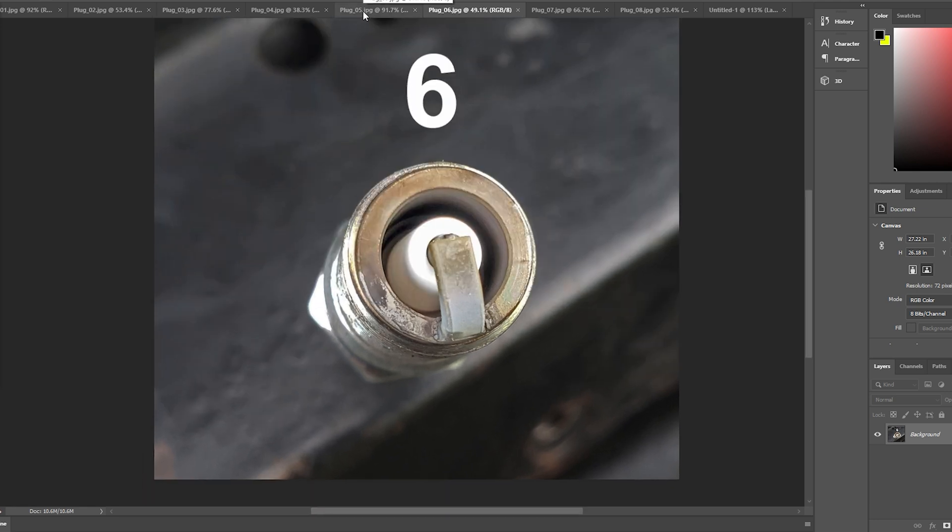That's pretty much all I've got for today. I'm not a plug reading expert, but I am going to invest in some more tools — something like an otoscope or a magnifying glass with a light so I can look down into the plug more easily to see the fuel mixture around the firing. That's really how you want to read how rich or lean it is, and it'll tell you a lot better story than just going by one wideband reading. Keep wrenching, don't forget to subscribe, hit the bell for notifications, hit the like button, and until next time — peace.